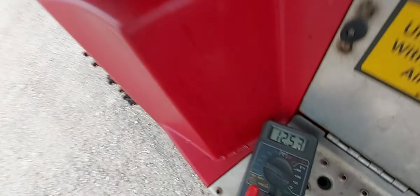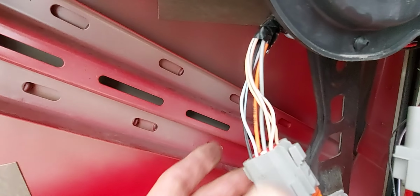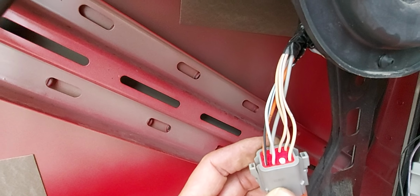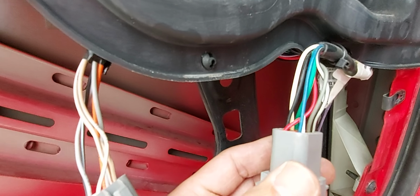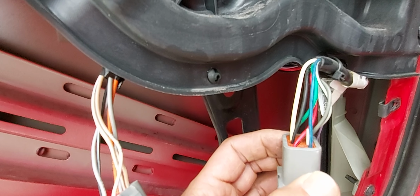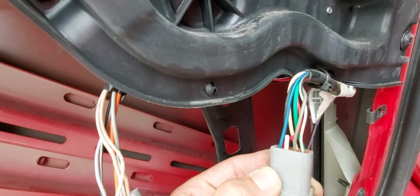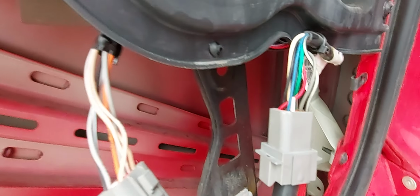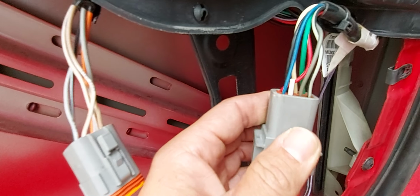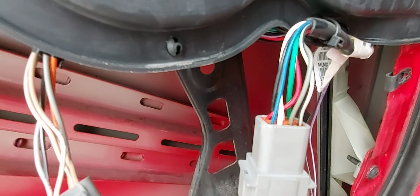So I was curious. I had this connector, and of course finding wire diagrams and everything to figure out which pin was what. This is the truck side harness, and this is the mirror harness. So I had to kind of decipher which one was which. And the temperature sensor could either have been a 2-wire or a 3-wire setup. I was kind of assuming it would have been like a potentiometer type of thing, with my electrical troubleshooting background that I have.